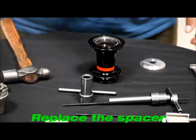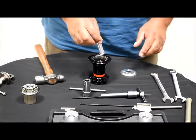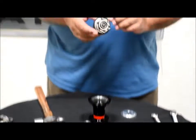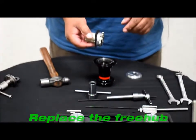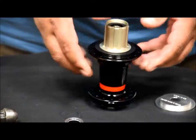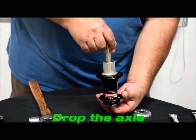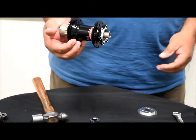At this point, you're going to want to make sure you take your crushed sleeve. If there are any shims with it, make sure they go in. Drop that over the bearing on the far side. Take your free hub with the seal installed onto it and work it in — just push it down. Put the free hub in so the pawls engage the ratchet ring past the bearing. Drop the axle in to line up the crushed sleeves, all the way through the bearing.